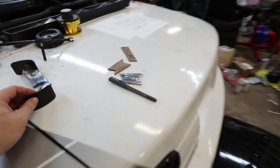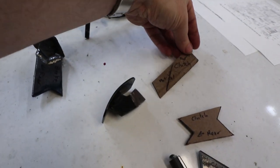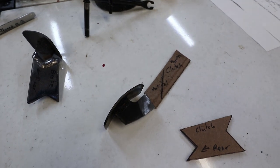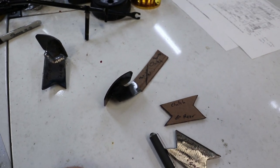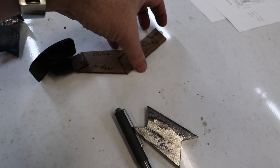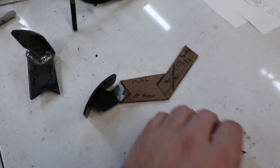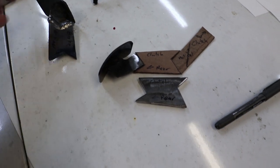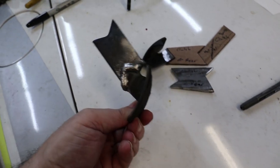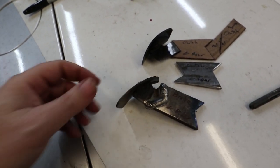Figuring out the approach, I've got my pedal piece here and I've made a little cardboard template of the top part of the pedal - it kind of went like that, and I marked the line where vertical was. I made a little template for a spacer I want to create. If I make a little metal piece like that, it's going to move the pedal back two inches. Here's my little metal piece that I made from the cardboard template. For the brake pedal I've done the same - made a template and already welded this one together. The next step is to weld this on under the dash to the car.